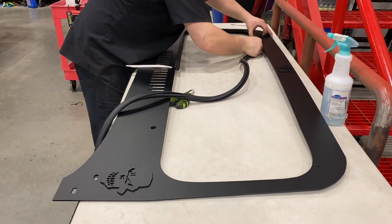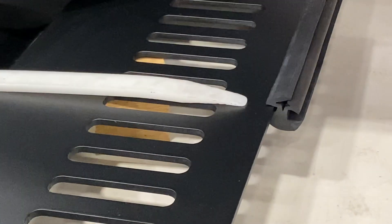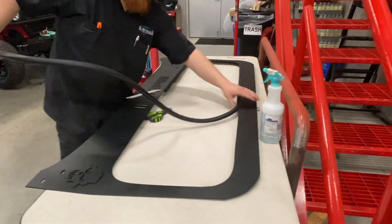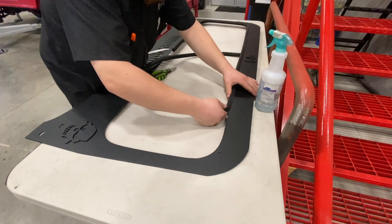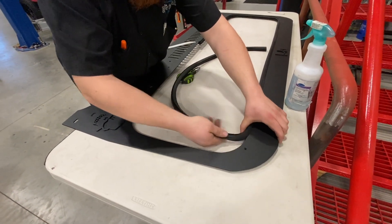Guys have installed the glass — it's not impossible to do on your own. We're doing a little video showing you — he's putting the rubber seal in right now. I'll zoom in and show how this should sit. He's marked center of the vent and that's where he started with the end of the rubber. You can see this is where the glass is gonna sit, and this is your lock channel — that needs to be on the outside of the windshield, the front side. He's going through and throwing the seal on it. We always do this part dry to save you some headache.